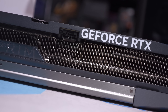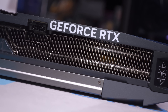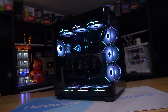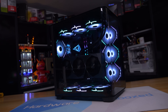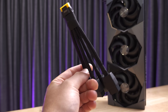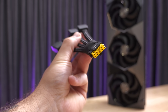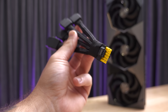The single 12-volt high-power PCIe connector is placed in the middle of the card, and because it's embedded about 10mm within the frame, it can be a little bit tricky to access. The supplied MSI 4x8-pin to 12-volt high-power PCIe adapter features yellow insert tips, which helps ensure the power cable is seated correctly during installation, greatly reducing the risk of connector damage caused by overheating when it's not inserted all the way.